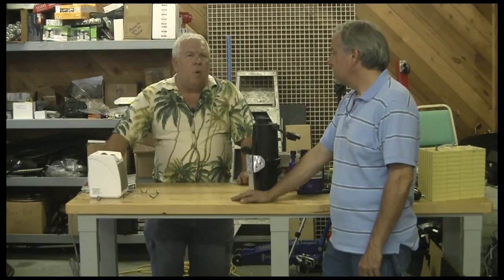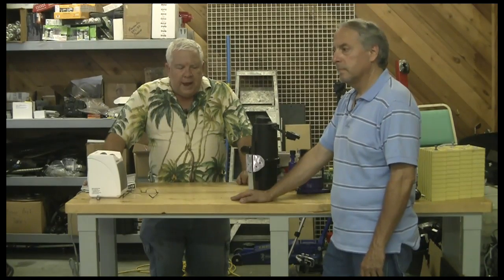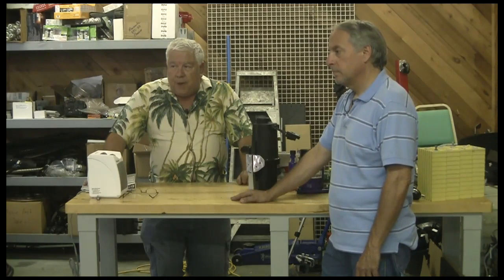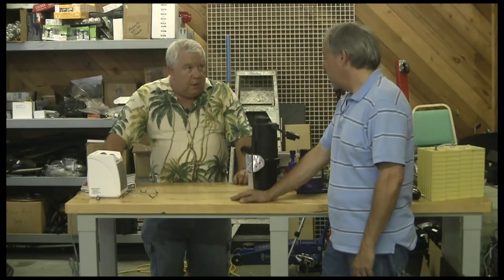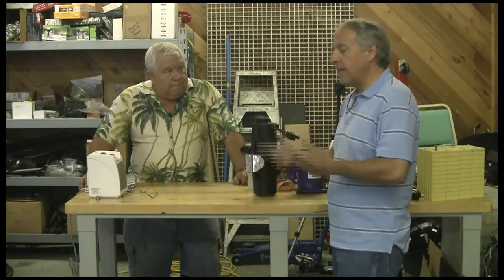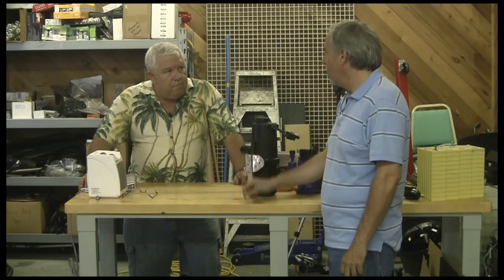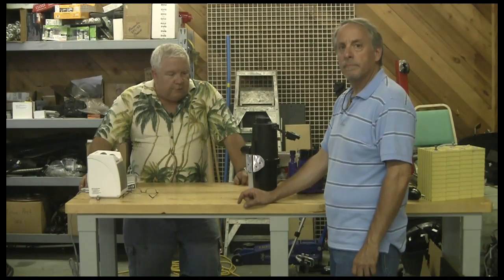We may hunt down a couple of wires to steal some signals. That environmental system on that dash — we've tried it. We have the engine out, we hooked up the battery, and the air blows, it switches in the different modes, and it all more or less works. Our comfort system really is working — obviously we're not cooling or heating yet, but the blower's working. We need to track down a couple of signals and some 12-volt. The modes seem to know what mode they're in. That's a huge gain.